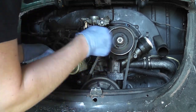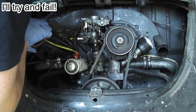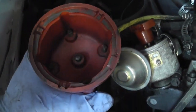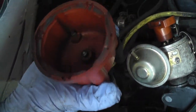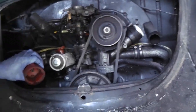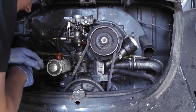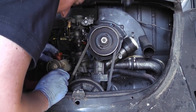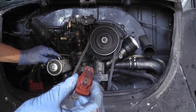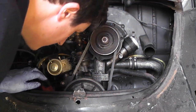Because it was such a long manifold on a Beetle, the tendency is for the manifold to freeze because of vacuum pressure differential. So we'll actually take off the inlet manifold as well — it's a fiddly job, but we're here to fix the car so we may as well. Let's have a look at the old distributor cap. It doesn't look to be too crusty and the rotor arm is pretty good as well. They do look like they've been done recently, so maybe somebody replaced them in the pursuit of running problems.